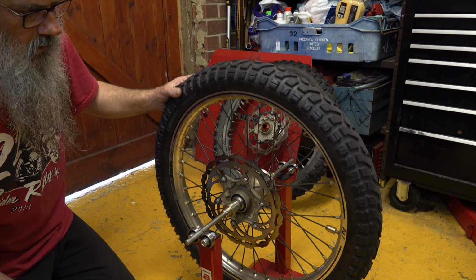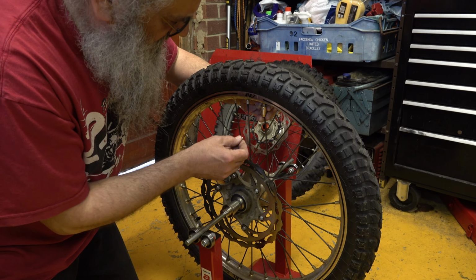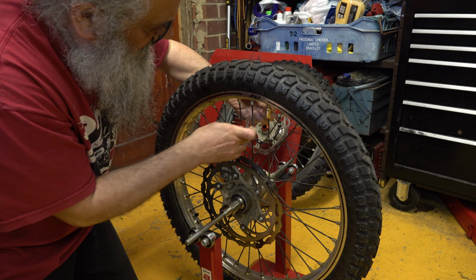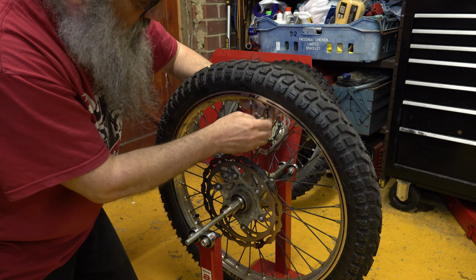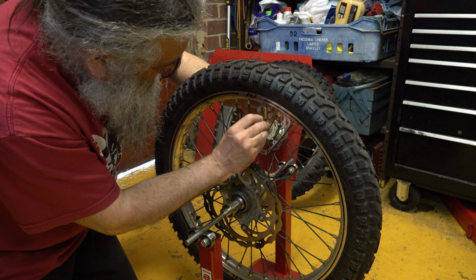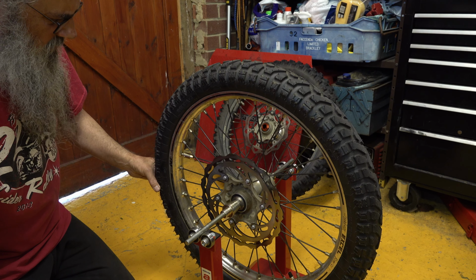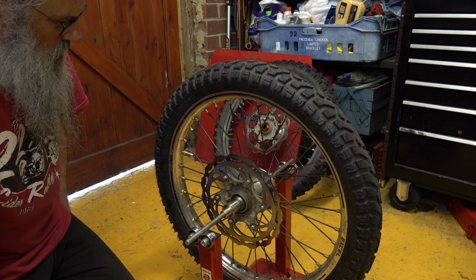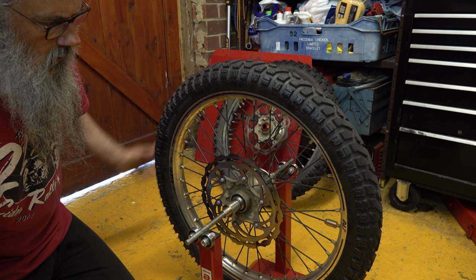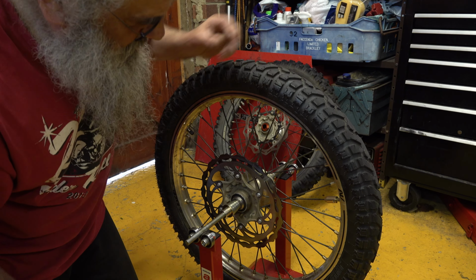That's going up again. So that suggests I need something that's slightly bigger than that one. I think the next one up is this one. So try that one and just do that by trial and error until I get one which seems to balance out. So let's again put that at 90 degrees, see what happens. It's fairly close. Yep, still great. That surprises me, actually.